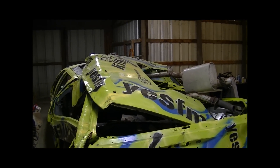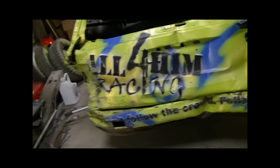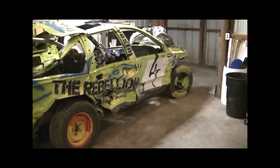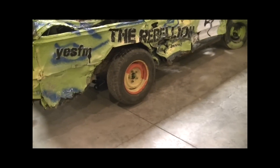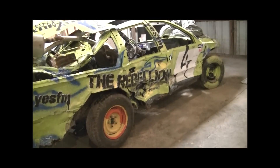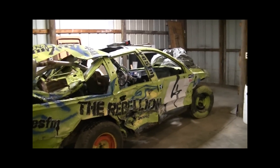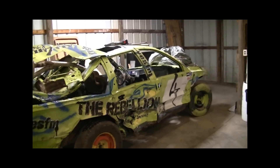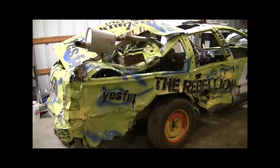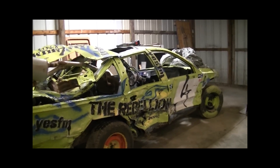Just kind of a fun little project we had to work around with all the snow outside. We needed the car turned around and had to get creative. Sometimes when you don't have the money to go out and buy things like those dollies, a nice sturdy floor jack underneath the rear end — you jack it up and you can swing the back end right around and just work your way around. As long as you take your time, do the front end, roll forward or back, whatever you've got to do, you can make it happen. Short video showing how we worked around a little issue — now we're ready to get the engine pulled. Until the next video, talk to you later guys.